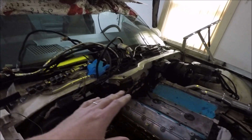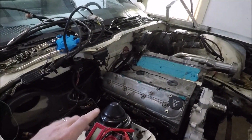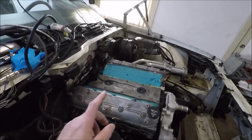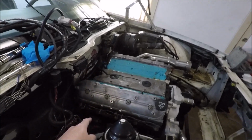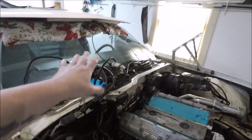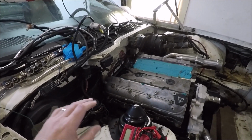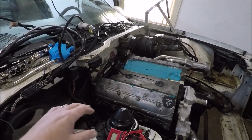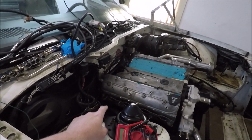We were testing a few other things. I was trying to figure out what was going on, so I had my multimeter out here, and we also discovered that when I turned the headlights on, I had 9 volts at the starter wire, and that was with the key completely turned off. So at that point, I realized that what was going on is every system in the car was trying to ground out through my multimeter while I was checking that wire.